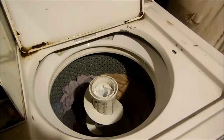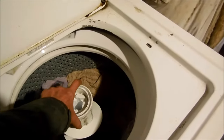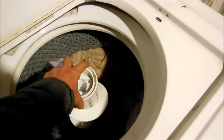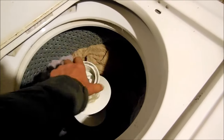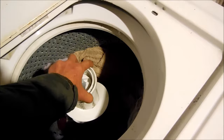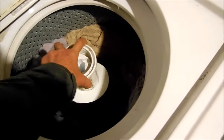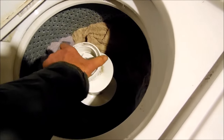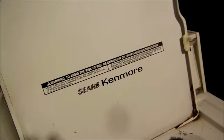In conclusion, this is the proper action for this agitator. You can see when I try to turn it counterclockwise, it does not spin freely — it would automatically spin the bottom part of the agitator. And it should spin freely clockwise. So counterclockwise it should grab the bottom of the agitator and not spin freely, but clockwise it should spin freely. That's typically how they work. Thanks for watching.